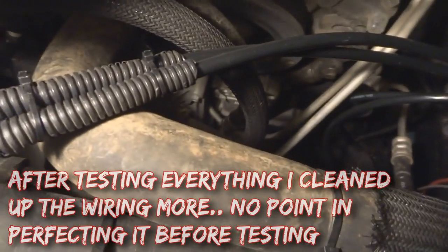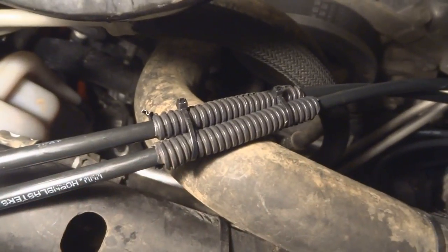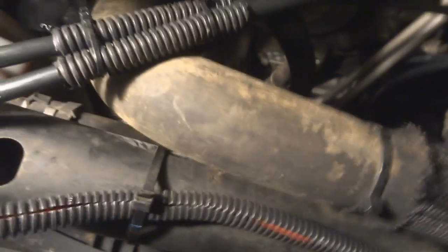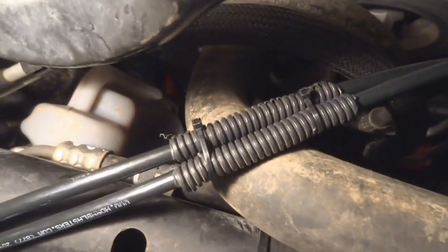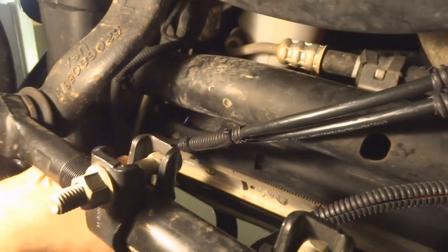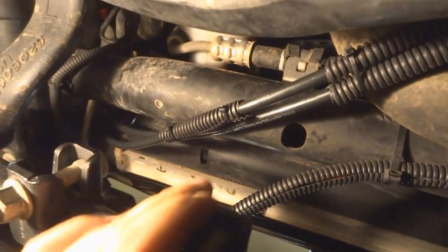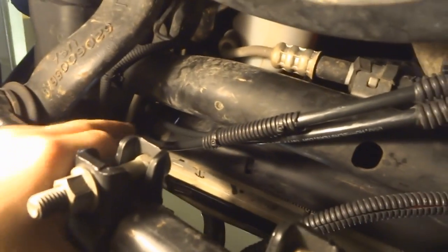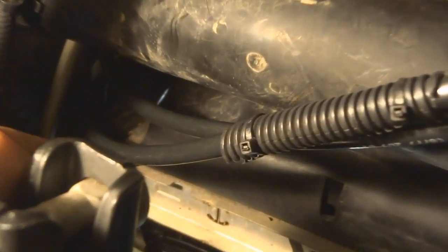The air line runs from the valve to each of the horns. You can see that the air line is close to the radiator hose, so I take some wire loom and wire-tie it around the hose where it might contact coolant. Coolant hose only gets about 200 degrees, so that's fine — but if it were near exhaust you'd need a heat shield. I wire-tied another piece of wire loom snug enough to position but still slideable, and slid it up so it's no longer touching the radiator.